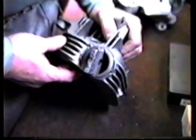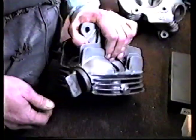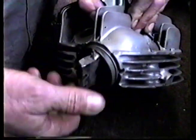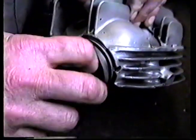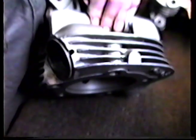We're going to take the spigots out of these things and replace them with late model spigots. What we normally do is we weld a slug of metal in there, put it in a vise with our wrench, and unscrew them out of the heads. First we have to grind the rivet off and punch the rivet through — that sort of thing.